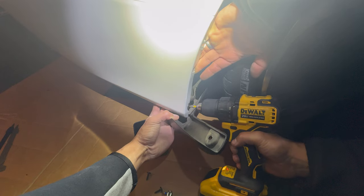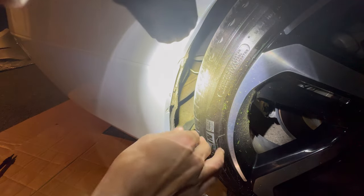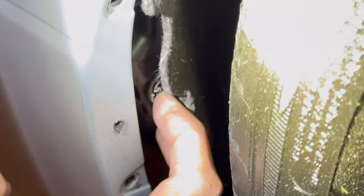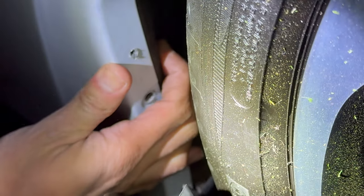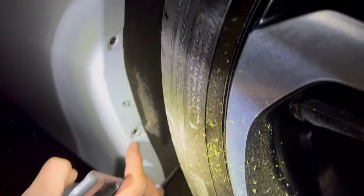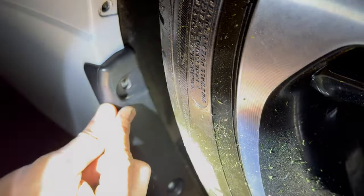So what we did — which we already did on the other side to make it work — was drill a hole here and one over here. Just so you guys know, if you're gonna do this I would recommend drilling the holes before actually putting the bumper on. We just didn't realize we needed to drill the holes, so we're working with what we got. The way to put the screws in: there's gonna be the bumper, the liner, and then the plastic piece behind it. So we gotta put the liner behind the bumper — that's how it's gonna go. First you do the top screw and the middle one for the bumper itself, then the last two go with the mud flaps.